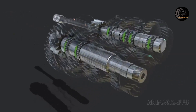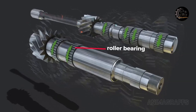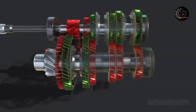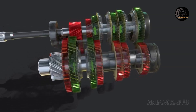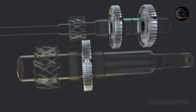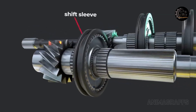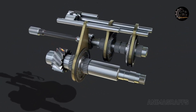To make gear shifting possible, one gear in each set floats freely on its shaft riding on a roller bearing. The other gear in each set is either connected with splines or directly machined into its respective shaft. For power output, the floating gear in each set must become securely connected to the shaft through the synchronization process. Between each gear set, there's a synchronizer hub that splines to and rotates with the shaft. A sliding shift sleeve is also driven by this hub, which can be moved back and forth by a selector fork. Forks are connected to sliding rods that are held by the external casing.